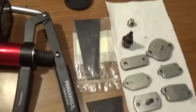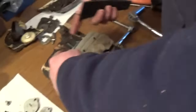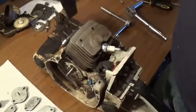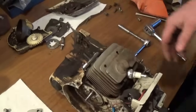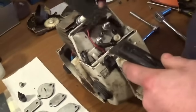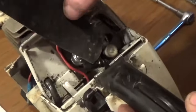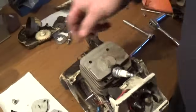What you do with these instead of the adapters is you will use your original muffler with its bolts and nuts, slide it in, and bolt the muffler down. You will basically do the exact same thing for your carburetor — apply it where your carburetor would be and tighten the carburetor bolts down.